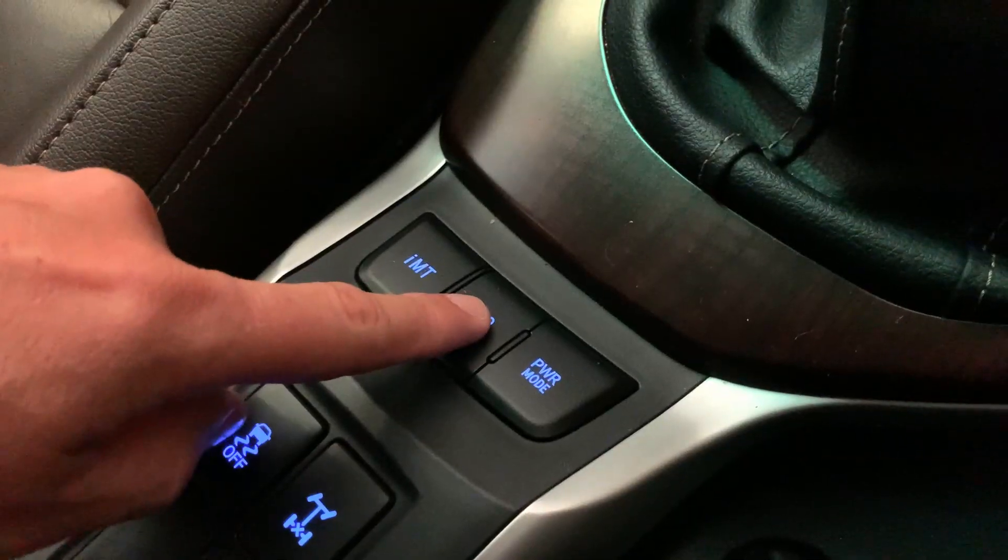I put it in the most aggressive mode — I think A8 or A9 — and it was really worthwhile for sand. There's also an economy mode which is much softer than the standard economy mode in your vehicle. The theory is you can use it in rocky situations where you just need a little bit of throttle input — usually I would crawl obstacles, but if you need to accelerate you can do it very softly, which reduces stress on your drivetrain. When using traction control you just need a little power for the wheels to start spinning and grip again, but a very high throttle input sends much more power to the wheels causing more stress on components.